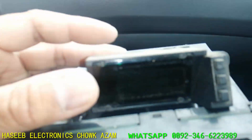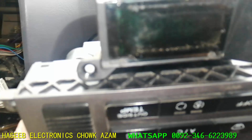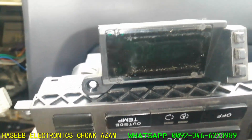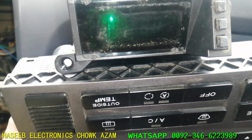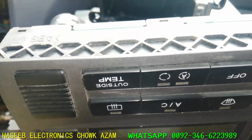I have these three panels now: air conditioner, car tape, and the clock. We have these three items damaged. Why are they damaged? The problem was the car dynamo — the car generator, the car alternator — it was faulty. It was giving excessive voltage. The cutout or voltage regulator was not giving proper output. That was the reason it damaged electrical appliances in the car: it damaged the light of the clock display, the air conditioner panel, the car tape, and many other items in the car cabin. So please, always work properly.